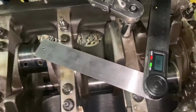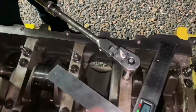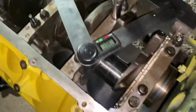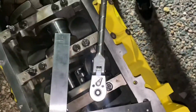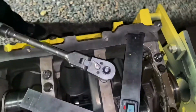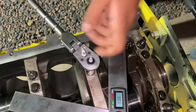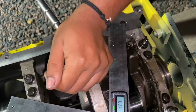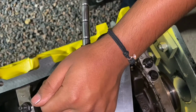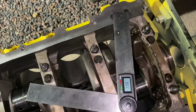All right, here it is, guys, how we're doing it. 80 degrees. We got a ratchet. You could use a ratchet or breaker bar. You see we got the angle sort of matched up, the ratchet in the 0 point. Now we want the ratchet facing this way like this. And I'll show you how he does it. Go. And then about right there is where he's gonna end. And that should be torqued to around 80 degrees.